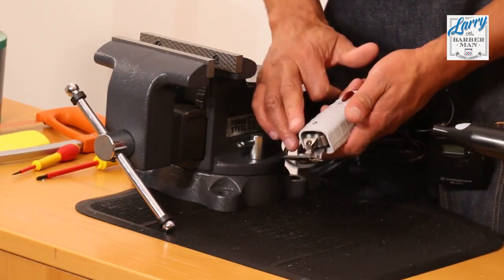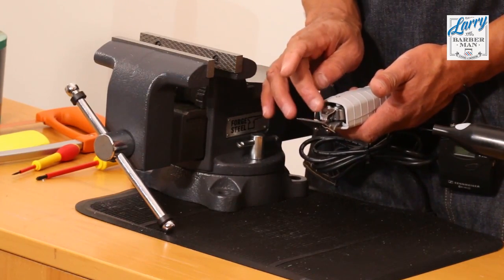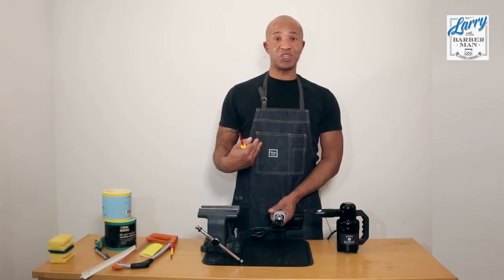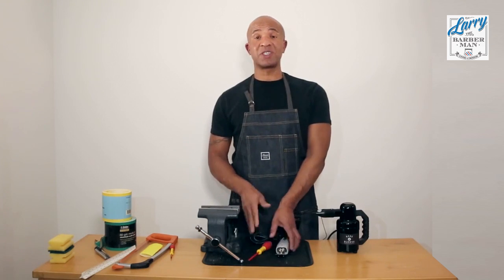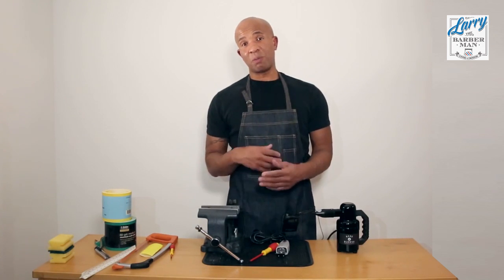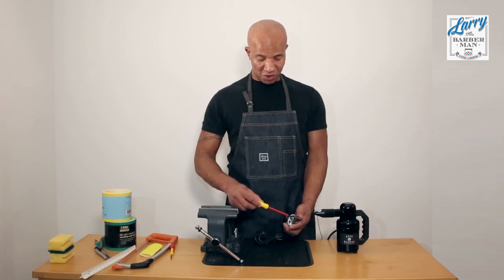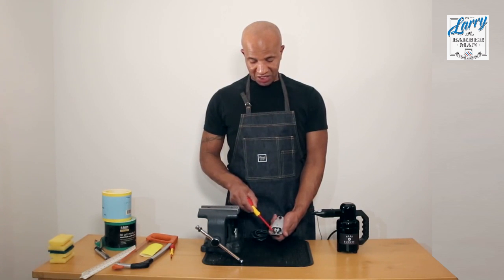And like I was saying, on this particular trimmer, the tension point is this particular screw here. So when it's underperforming and not cutting as it should, even though the blade is really, really sharp, that means the tension's off. Because if it isn't the correct tension in exactly the right place on the blade, then that will stop the blade from cutting the way that it should. But if you look in one of my other videos, you'll see the process for tuning it. So it's just a question of tweaking this screw here, and you'll see this spring going up and down the hole that is in the blade.